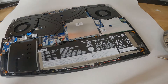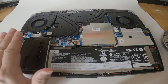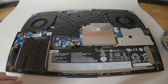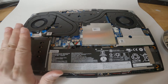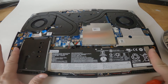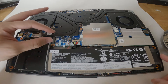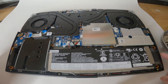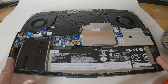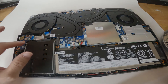There we go. Here's what the inside looks like. Here's where we're going to put our solid state drive right in place. It's a dummy which we're going to take out. Keep in mind, once you put the SSD in there, you cannot buy the extended battery. The battery is this long, and if you install the SSD you can't put the NVMe chip in there. So it's either the NVMe drive with a longer battery, or just the solid state drive.